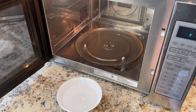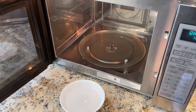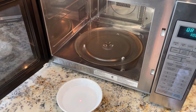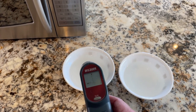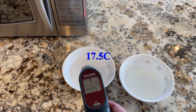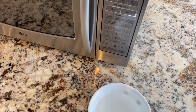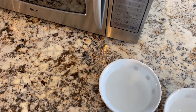We have a microwave here and we believe the magnetron has been slowly degrading over the last several years. We're going to measure the actual increase in energy when we replace the magnetron. We have two identical bowls of water and we'll be taking a starting temperature of both just as they go in the microwave, then putting them in for one minute on high power to measure how much energy goes into the water.